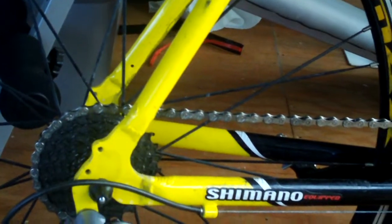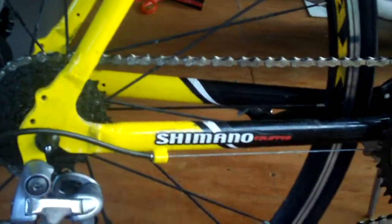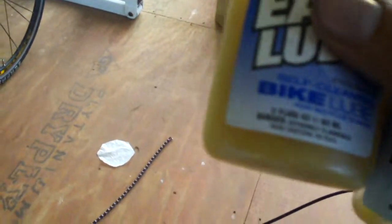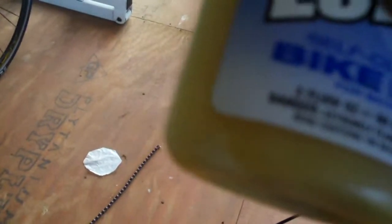It's also important that you regularly lube and clean your chain. Here I have some easy lube. I have mixed opinions about it — I don't think it does a very good job of prolonging chain life. I used it initially in its regular form and it didn't seem to lube the chain well, so I added a little bit of Marvel Mystery Oil into it and mixed them together, so you still have the wax lube to shed dirt but with a little extra lubrication. It's hit or miss, but it's better than nothing.